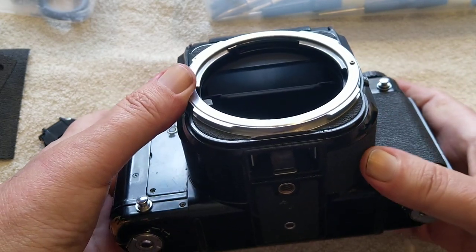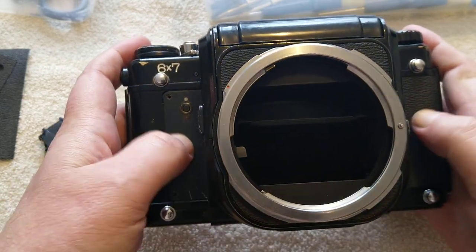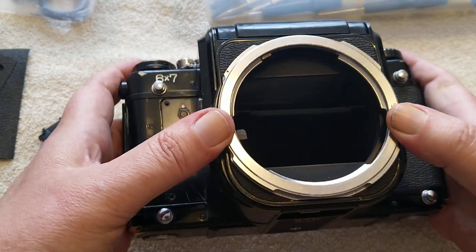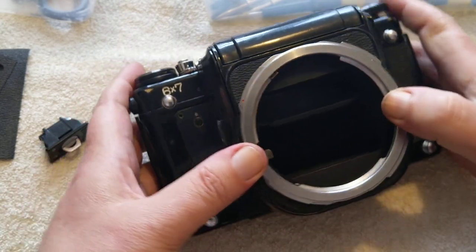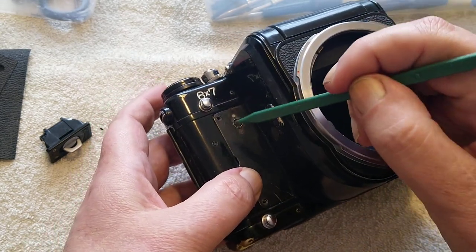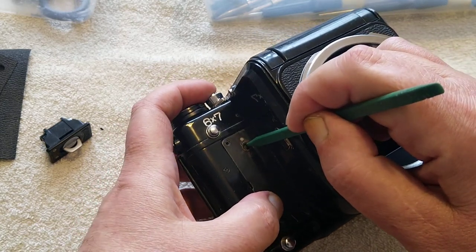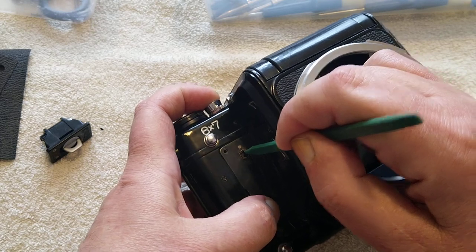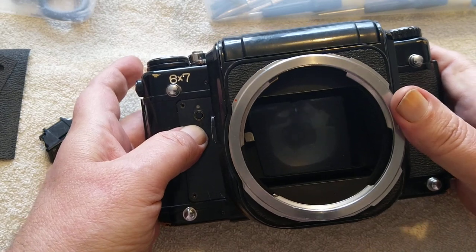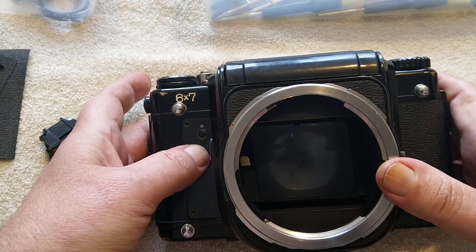Low battery power, a dead battery, or a fault like this one had — even with a fresh battery — was doing this maybe three times on a roll with film. It gets very, very frustrating. There is a way to reset this. I've seen some YouTube videos where they've done this wrong. There's a little reset button here that you push in. Flip the mirror and then at the same time press the shutter release — that will reset the camera and send the second curtain across. But obviously by the time you've done that, your shot is ruined.